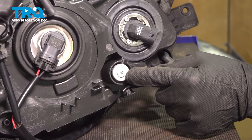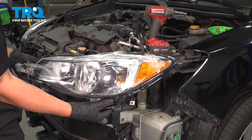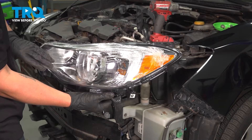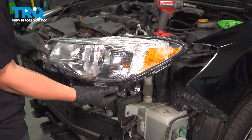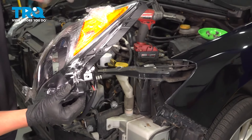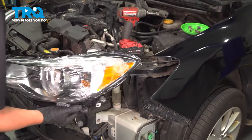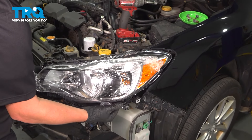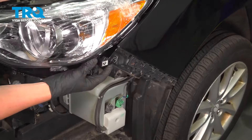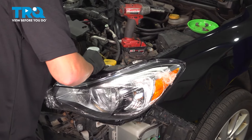This Phillips head is going to be how you aim your headlights. Now it's time to reinstall your headlights — I'm going to leave some of the plastic on to minimize scratches. You're going to line these two tabs up with these two holes, and there's a little alignment pin on the side that's going to fit into this side. Make sure your alignment pin is in, push in, and then hold the headlight with a 10 mil for now.